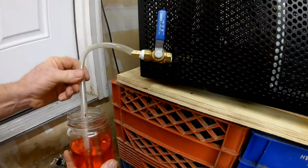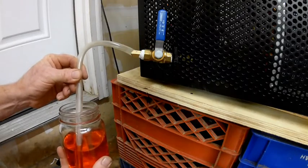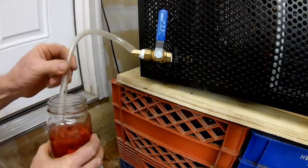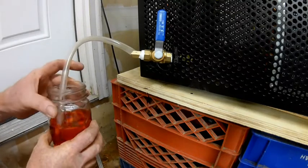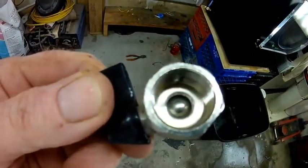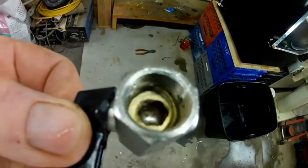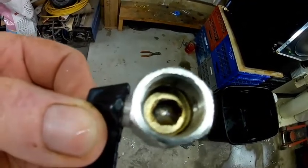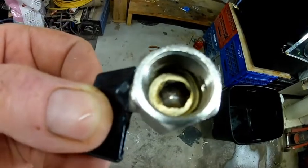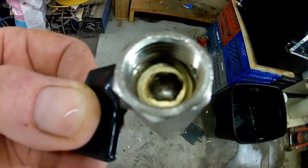It's not sucking up any more of the liquid. So that was my problem — it's a simple fix, and it's one of those fixes that are more unusual. I hope you find this helpful and it will avoid some of your frustrations in the future. This is my old ball valve. The drain hose side is nice and shiny chrome, but if you turn it over and look down inside, you can see that the chrome valve is all pitted, and the entrance to that valve is fairly corroded. That's why I was losing vacuum through this valve.